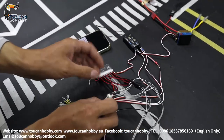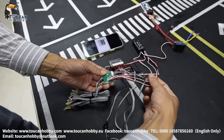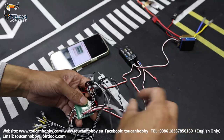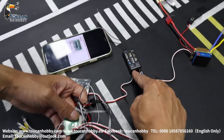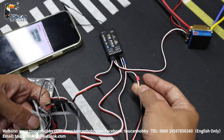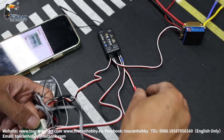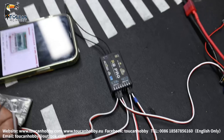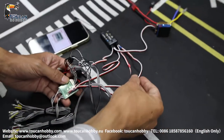For this Lesu light board, we have 3 wires for controlling. This middle one we connect to the light control switch channel directly. The red one with the red mark is the throttle line — running in parallel with the throttle. And this one is the signal line for turning, which should be connected together with the turning signal for the steering servo.